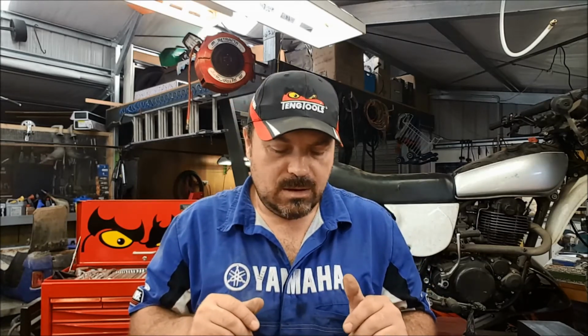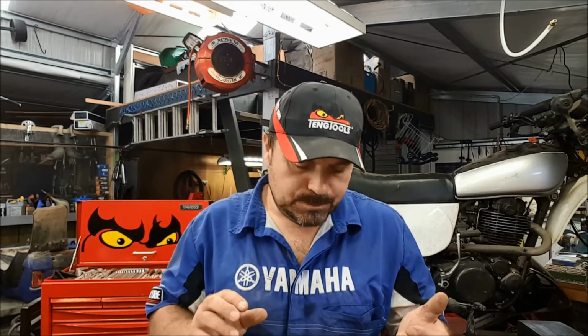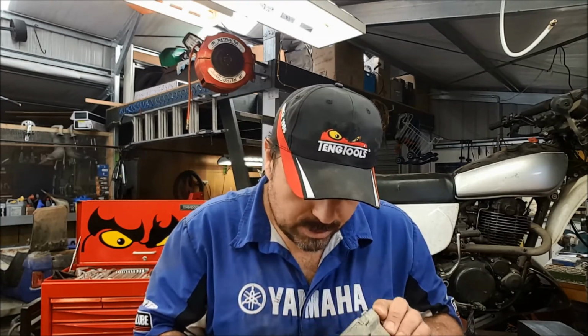There are specifications, which I'll give you very shortly, about what's permissible, what isn't permissible. If it's out of spec, if that bore's got distorted or excessively worn, doesn't look worn, then again it will be a fail, and we'd need to either send it away and get it rebored, or depending on if it's a coated bore, and it could well be, it may be a new barrel.